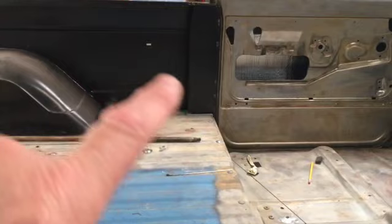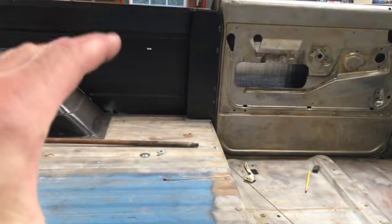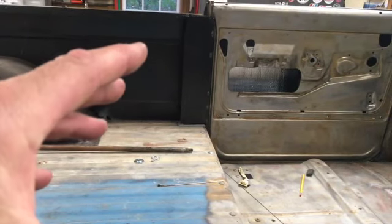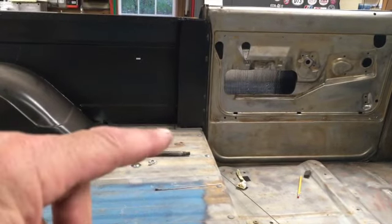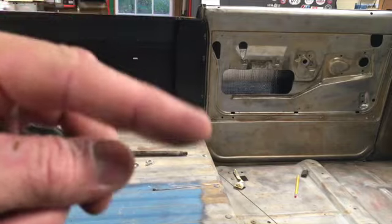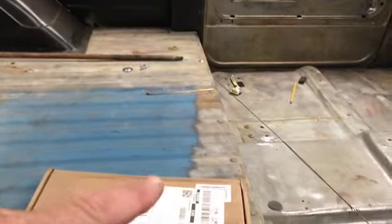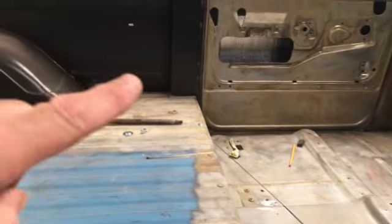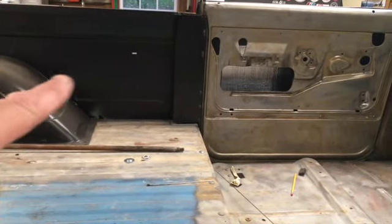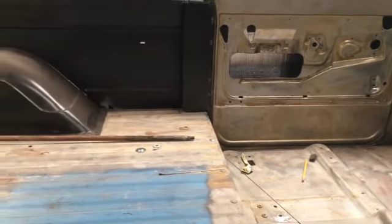I guess my recommendations: measure height here, measure the angle on the old panels before you pull them off, and have that for reference material for putting the new ones back on, and take a measurement side by side on the bottom, side by side on the top. Lots of measurements. Some of them I did do. I think I mentioned it earlier, after changing the left side, I took some measurements before I changed this right side, and it was helpful for placing the right side.